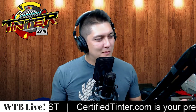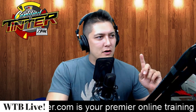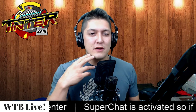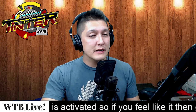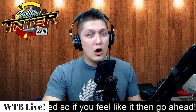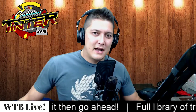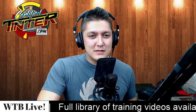Like I said, it wasn't a very long video, but it's not about the length, it's about the quality, right? So yeah, this is the best way. When I started doing R&Rs, there were videos about trash bags and sweating it and different things of that nature, but there was nothing out there that talked about what happens when you remove the tint and there's all kinds of adhesive left on the glass. That was one of the very first R&Rs I did on my own, and I flipped out. I didn't know what to do. I sat there for probably an hour or two hours, just scrubbing all the adhesive off that thing. It was a nightmare. If I would have known this, I would have been done in 5 minutes. So food for thought, and hopefully this is going to help someone save some time, and obviously burn and turn a couple more cars here.